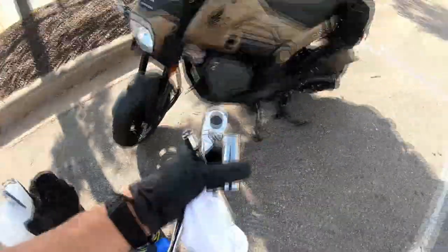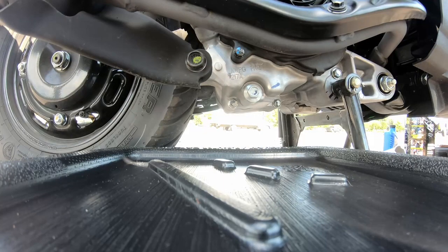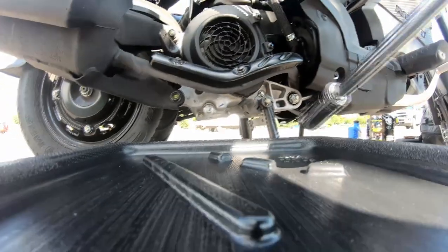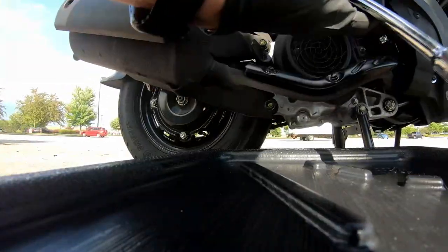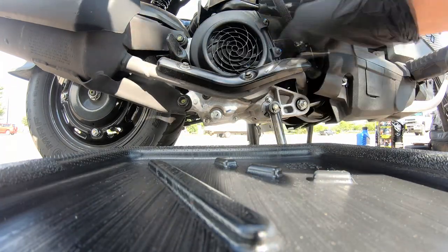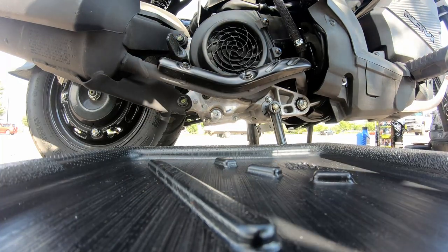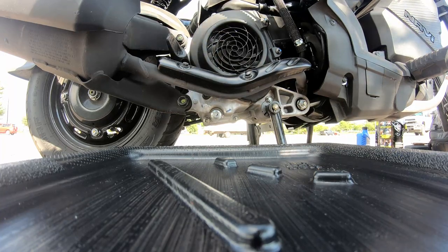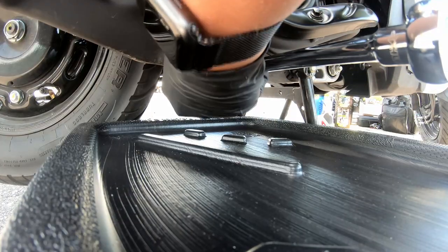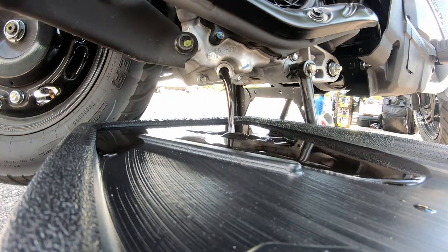Let's glove up. We actually use a 17 millimeter for the oil filter, and I got a six-inch extension to help with reach. Correction: this is actually for the oil filter, which is on the other side of the machine. The 12 millimeter — I was getting aggravated because I accidentally grabbed a half-inch socket. Fits like a glove. First oil change, yep, and the oil draining out — that is tragic.